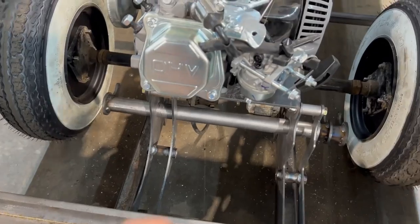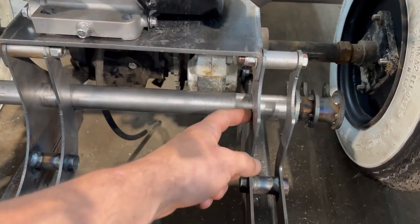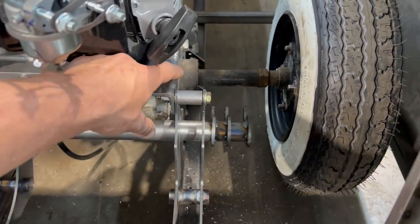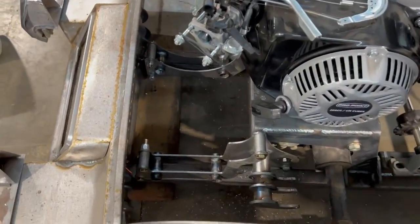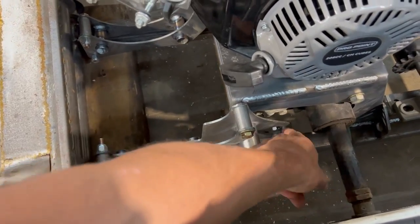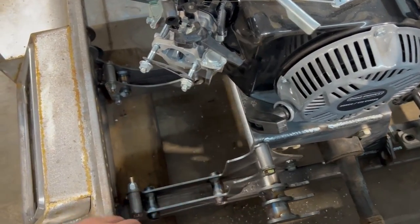So that tube in here, I ended up just drilling with the mill and a hole saw, just a hole further away. And then I also trimmed off the second bolt hole here because I don't believe that it actually needs it. We've got a bolt going to the chassis here, we've got a bolt going to the chassis here, and then one here. That's extremely strong. Yeah, I think that's going to be fine.